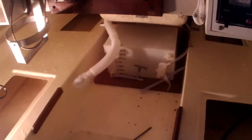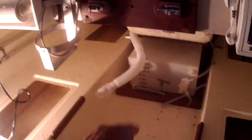And obviously more water came in the second time because I backed all the screws out and cut them off. Originally the screw was in the hole, a little bit, so only a little bit of water was able to seep in. Once I cut the screw off, obviously the hole got bigger, and more water was able to come in. Lesson learned: make sure you measure before you do anything inside. Don't assume that you have clearance.